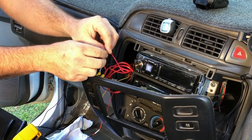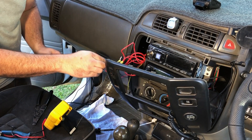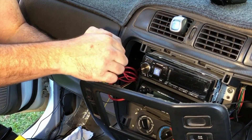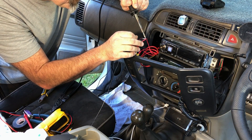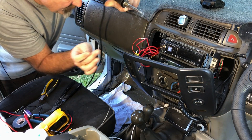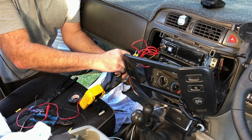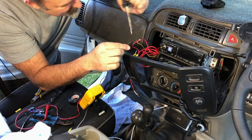I simply use my wire stripping tool to just put a break in the sheath and push it back, which gives me just a little bit of exposed wire that I can wrap my new cable around and solder with my soldering iron. When crimping electrical connectors for automotive use I always like to solder them as well, and it's a good idea to use heat shrink with glue to make sure they don't wiggle loose. The only downside to doing it this way is that you can't use heat shrink, so you just have to wrap electrical tape around it — but provided you do a neat job it shouldn't pose any problems.